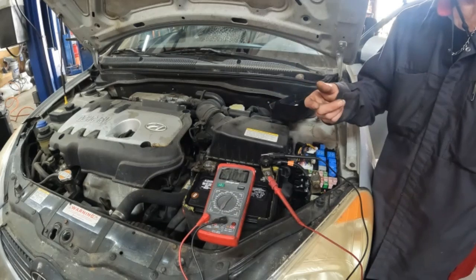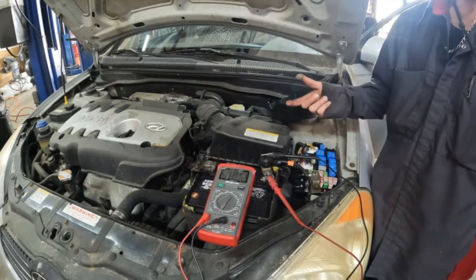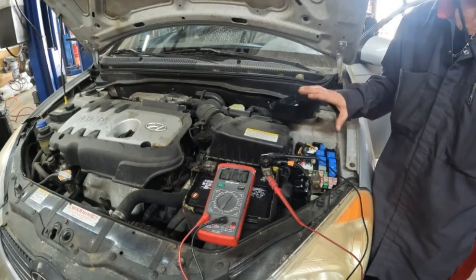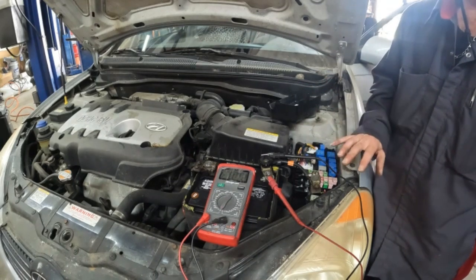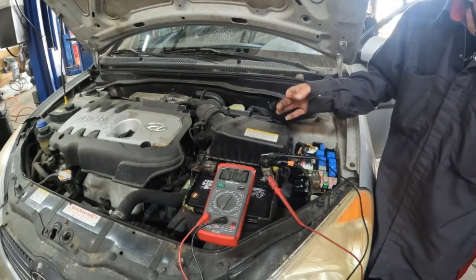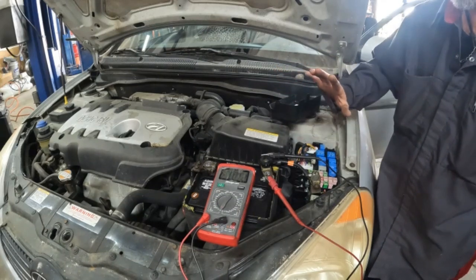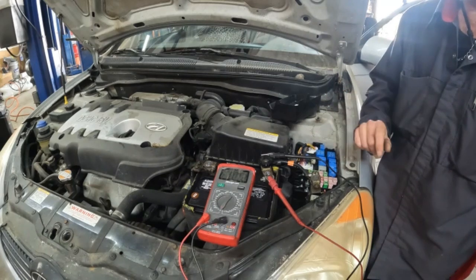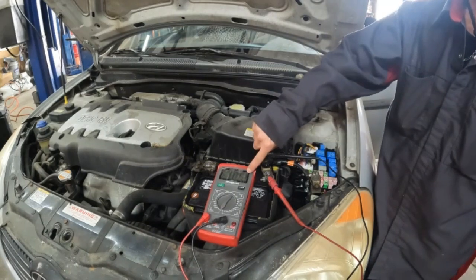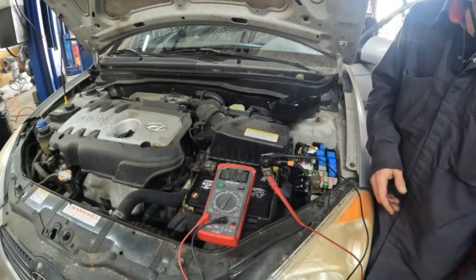just because, like on the GMs, you've got multiple fuses feeding one module, but you could have a short to power on one particular side, so it may require multiple attempts to find out exactly what it is. But right now there are no control modules staying on, body control module, PCM, and on newer vehicles, driver door modules and things like that. So this one is actually right where it's supposed to be. Like I said, normally you would start pulling fuses until you got down to roughly that reading there. And that's testing for a parasitic draw.